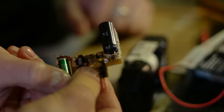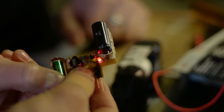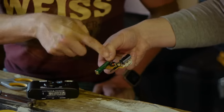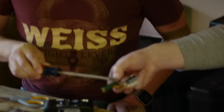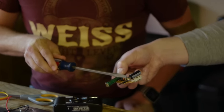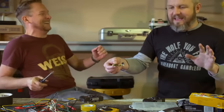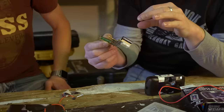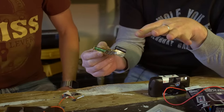Brian is touching a little button where you charge it up. I'm turning on — there it is. See the light. Even though I just did the equivalent of turning it off, that capacitor is fully charged. You want to make sure to fully discharge it. A safe way to do that is if you have an insulated screwdriver, and now I'm going to bridge these two contacts right there. It's never not scary. Before you dismantle your camera, make sure to discharge that first.